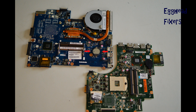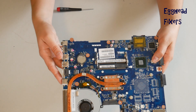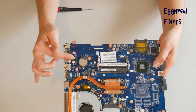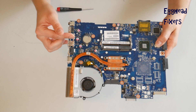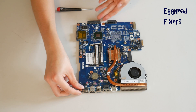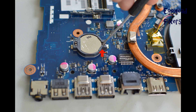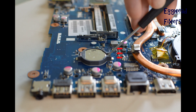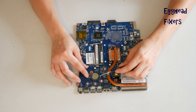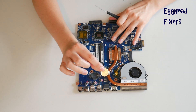Now, the cradle kind of CMOS battery. The cradles vary drastically from model to model. This is the most common kind, so we'll demonstrate on that. If you find your cradle looks different, you may have to adjust the way you do it — sometimes there's a flap or a piece of metal you have to move. For this kind, you take a screwdriver, set it there, and push it to the left gently, being careful not to break the cradle, because once you break it, it's very hard to fix.